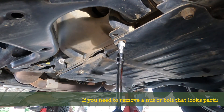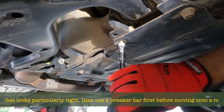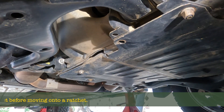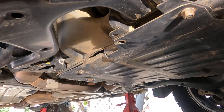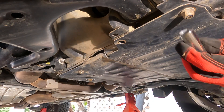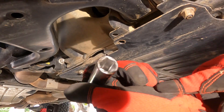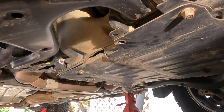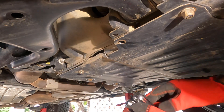We started it off with the breaker bar, got one turn, then switched to the ratchet. I'm using a long extension just to make it easier so my hands aren't in frame all the time. Let's see what size the others are — that looks like 13mm to me. Wasn't 13, it was 15. Always try to use a six-sided hexagon socket if you can instead of a star socket — they grip better, that's the bottom line.